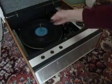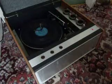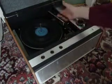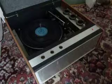Once the arm is on the record, carefully lower the stacker arm down so it knows to switch off at the end of play. If you leave it playing with the stacker in the upright position, that will trigger the repeat function and the same record will play over again until manually switched off.